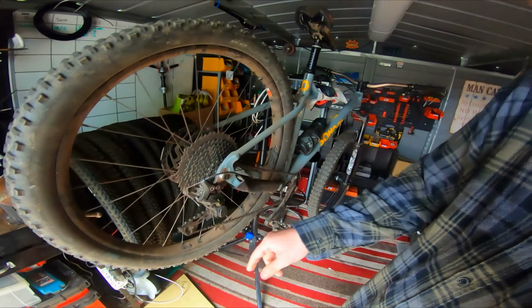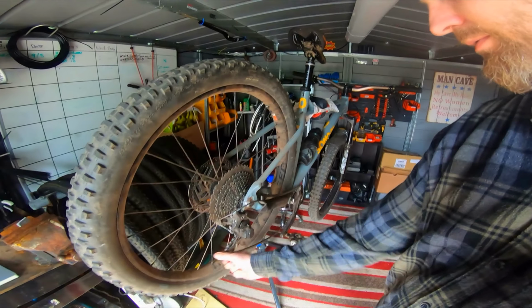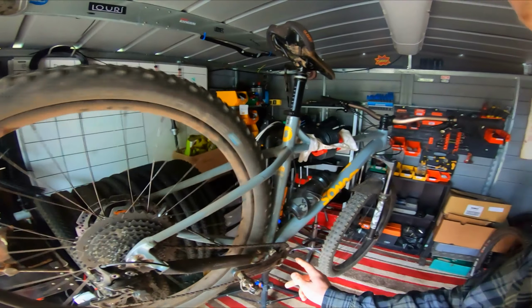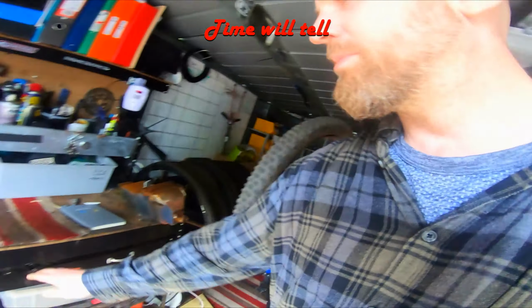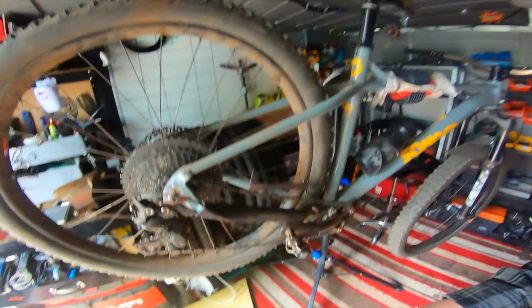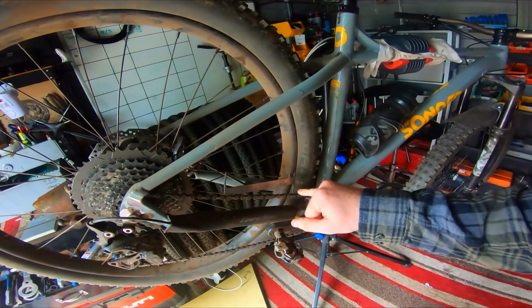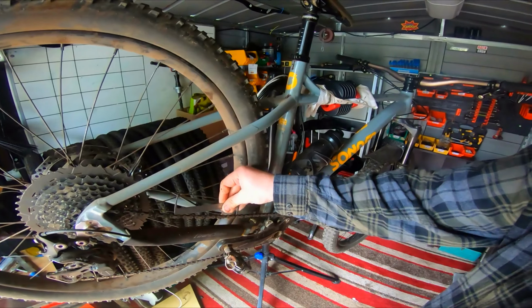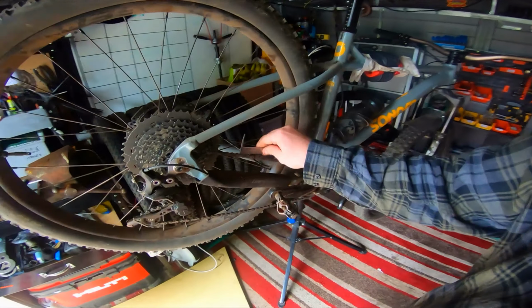So we're going to look at the derailleur, just make sure there's tension on that, which there is. Obviously with the clutch off, it's a lot easier. Again, these bloody Chinese cranks are incredible. But what I do every time after a ride as well, it's just habit. I kind of measure my chain just to make sure. As you can see, that's not even dropping through on the 75%. So there's no way obviously it's going to drop through on the 100%. So it is a fairly new chain. I think I've got like 4 rides on it. So chain check, chain's fine.